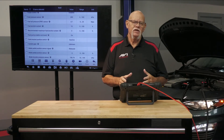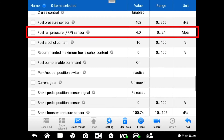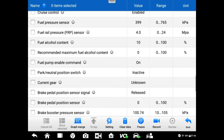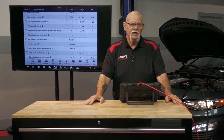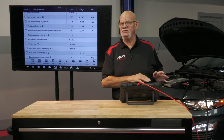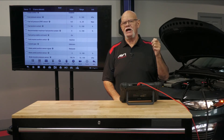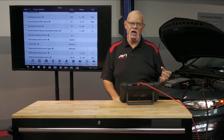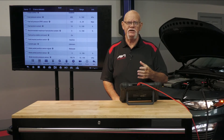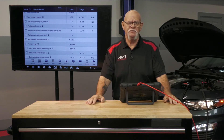High side pressure is not going to be a constant. Looking at it right now, it's dancing between 4.0 and 4.1 — a sweep of about a tenth of a megapascal, which is roughly 12 to 14 psi. Be aware: with sequential port fuel injection before direct injection, when the oxygen sensor dances in closed loop, what was changing was injector on-time. If the O2 sensor was high and we were rich, the computer would decrease injector on-time, the O2 sensor would drop — and vice versa. Think of that as short-term fuel trim, or micro-injector pulse width.